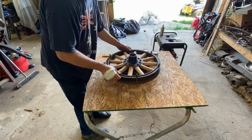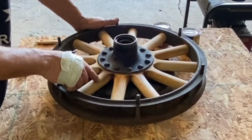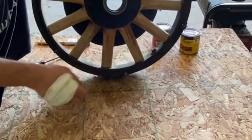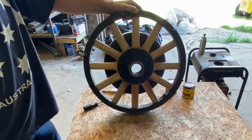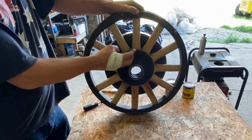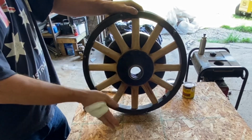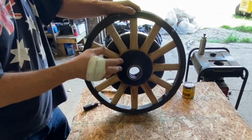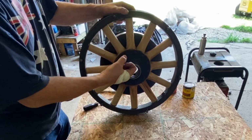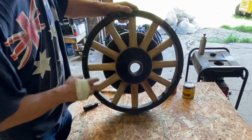One interesting thing to note is some of the dark staining in here on the wood, and it is staining, although I think it's going to add nice character. What this is from over the years of the car being parked, 75 years basically without the wheels turning. The grease in the wheel bearings started to liquefy. Some of it turns to real jello and tar, and then the liquidy stuff kind of runs out and kind of stained the wheels a little bit.